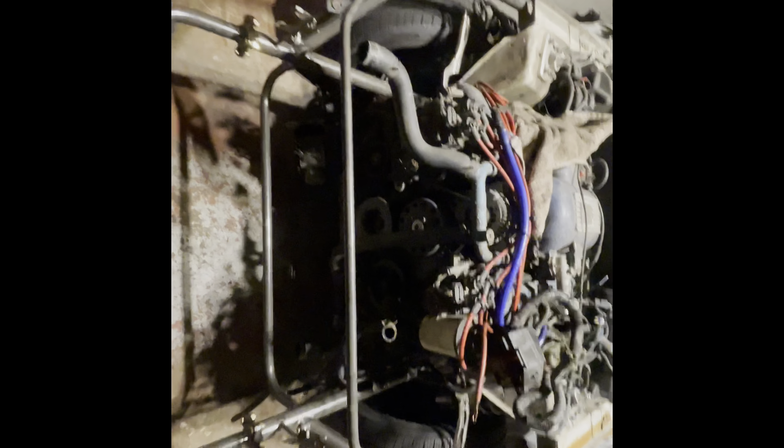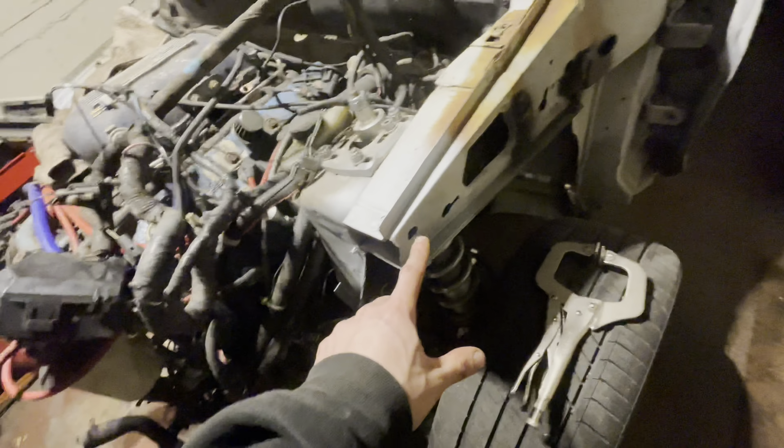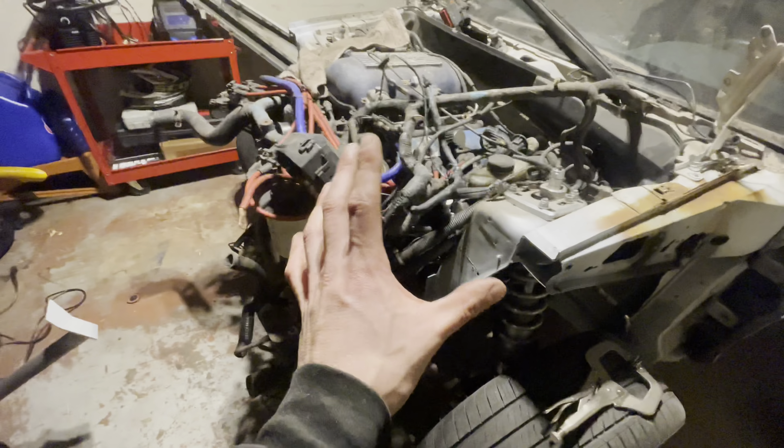Then we'll burn her in permanently and we'll be on our way to having a Mustang back. I've never personally done any work like this, so please don't judge me. My welding is not that great either, but I'm going to get it done. I want to build this car myself — I want to be the one to do everything on this car, short of the bodywork and paint. So we got all of this ground down and weld-through primed all the way back up to here and all the way down to right about there. Now I'm going to put this back up here, clamp it in place, put our bolts back through, and weld it up and get it permanently on the car.